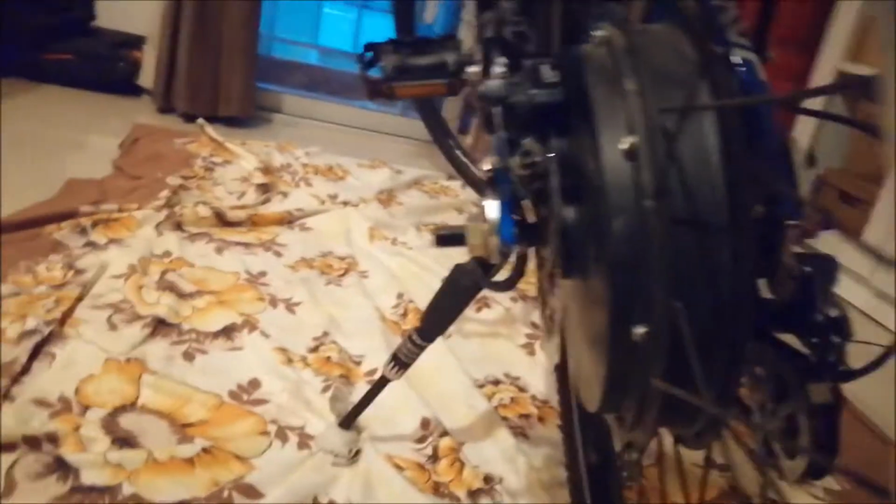And here in the rear, I had a little issue that when I shifted to a high sprocket, the derailleur had contact with the motor. So I adjusted the gear set so that it stops at the sixth gear in the back. So I have a protection layer in the form of the sprocket, so the chain doesn't flip over between motor and sprocket. And I spaced it out left and right side with a stainless steel washer, so I have a nice clearance on both sides, and it's parallel from side to side, so that's great.